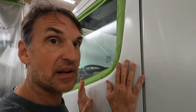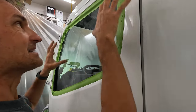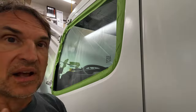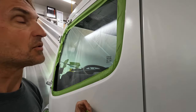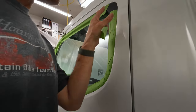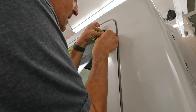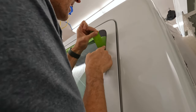Being that I'm shooting this with a gun — pressurized air — I want to make sure no air can sneak in and get on the window or the trim. The trim will be really hard to remove paint from if any gets on it. I'm also getting really close, at eye level to what I'm taping. Coming up to this higher portion, I do the same thing and try to overlap the existing tape.